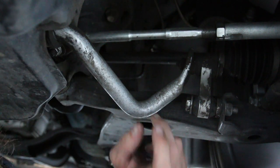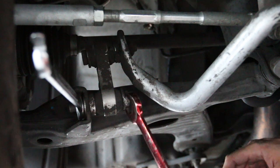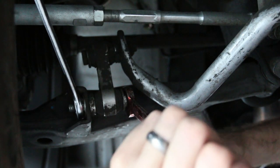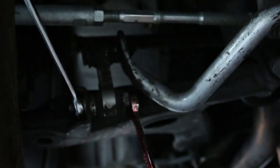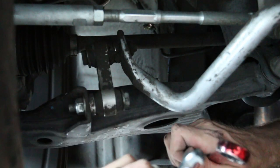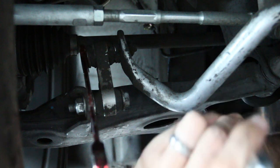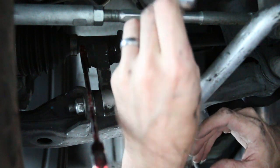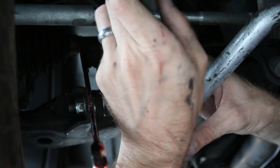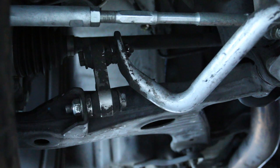They are on the softer position — these are soft and the rears are set to hard. This one was super loose and we're just gonna tighten this up. That was way loose, definitely the noise it was making. I like to have them tighter than looser because I find that they stay tighter and they stop making noise. I used the torque wrench on them before and found that spec was way too loose, so I just kind of do it by feel now. The top one felt good, it's just this bottom one that was loose — I'm pretty sure that's what was making the noise.